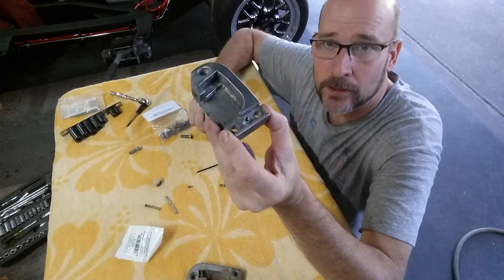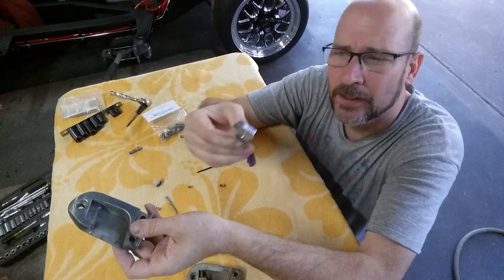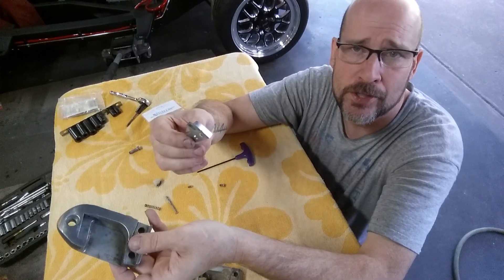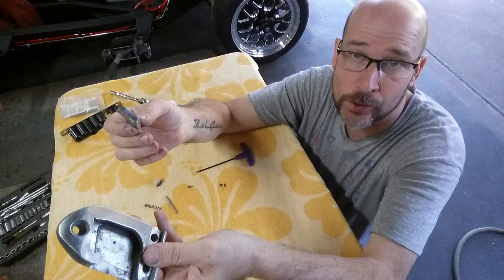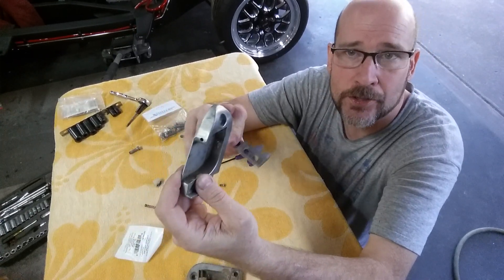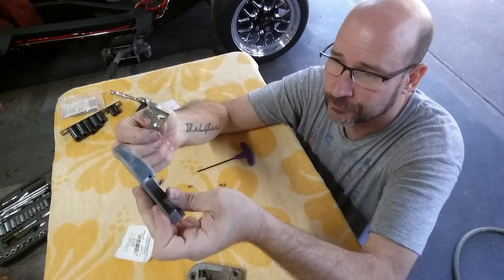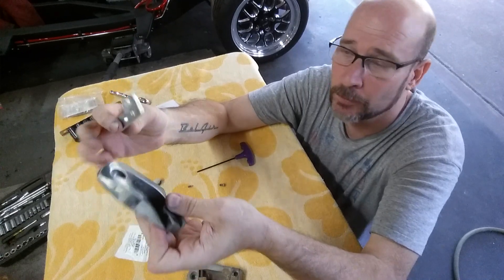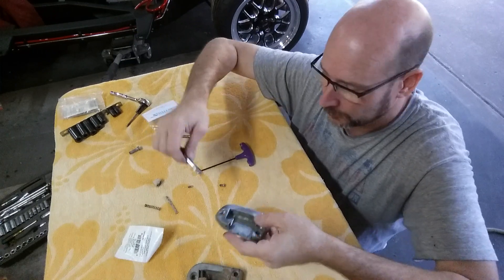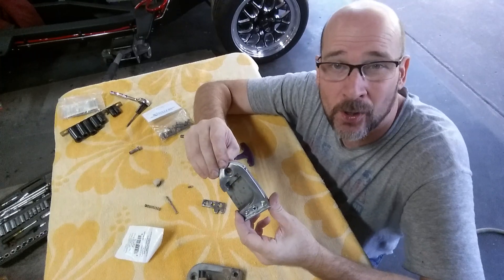Being as this is pot metal and this is steel, I thought about having these chrome plated, but the money I'd spend on having these steel tooth plates chrome plated I could probably put just a little bit more toward buying the billet aluminum strikers. So what I decided to do is sand and polish the pot metal housing and the plate until they look like chrome or at least polished aluminum, then clear coat them to keep them from tarnishing or rusting. Pot metal — you can polish it all you want but it tarnishes real quick and turns gray.